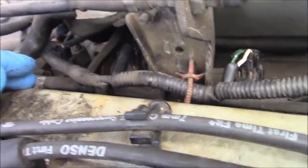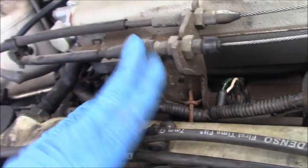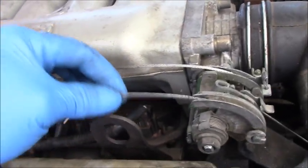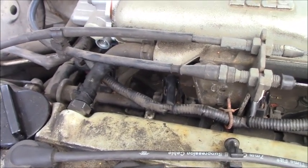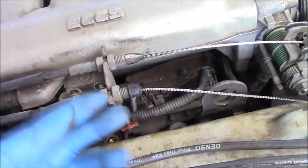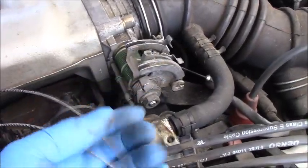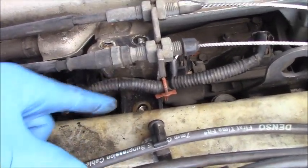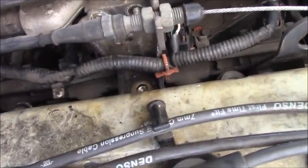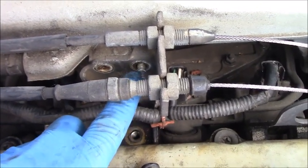And then, in order, I have to disconnect the number two fuel injector connector and the number three, and I have to remove the bracket and throttle body cable, okay? And let everything be ready, and you guys can see that. To remove the throttle body cable, you see I disconnect the cable here from the throttle body and keep the cable in this bracket. The 12 millimeter bolt down there I already removed, and two 10 millimeter nuts right here removed.